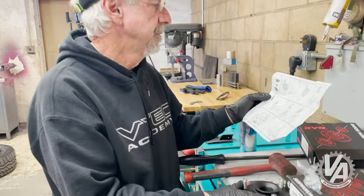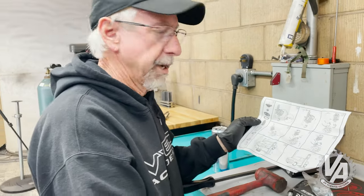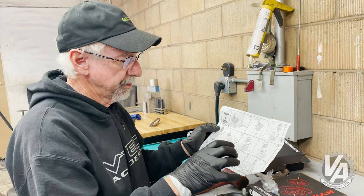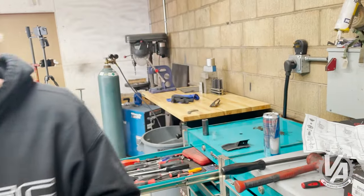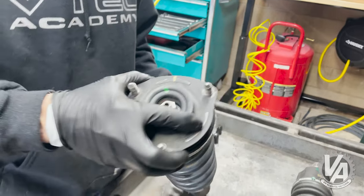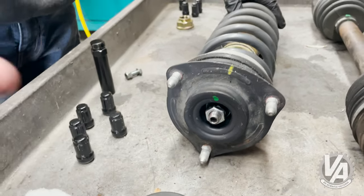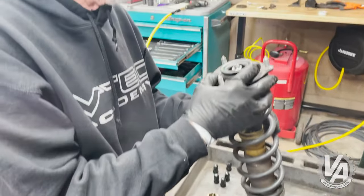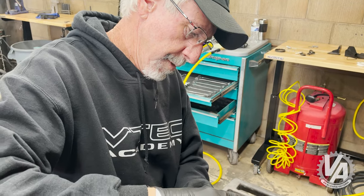Any special instructions? We'll need a spring compressor — actually we won't, because you've got progressive springs. If we were putting them on a stock system, the springs would be under pressure and we'd need a spring compressor. They look pretty dead on. This one does not make any noise. Do you think maybe it didn't get torqued down enough up here? It makes so much creaky noise. It uses those two to lock them together — it's really hard to get it to lock.